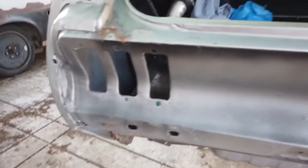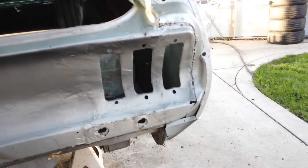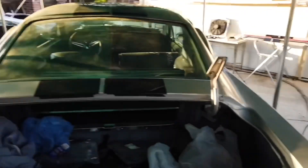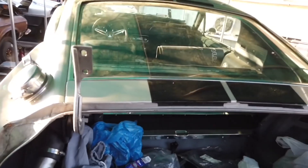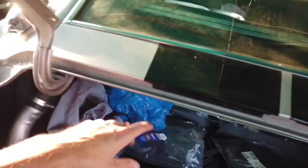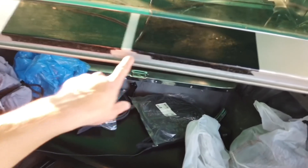The best I can do is clean this up a little bit and then throw some kind of paint, sound deadener, maybe some bed liner coating or something. I also removed the trunk lid because I've got to do the weather stripping — install that underneath the trunk. The best way to do that is to have the trunk off and upside down, then glue the weather stripping on there. I was going to clean up and maybe paint this section a little bit cleaner.